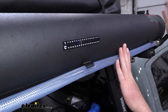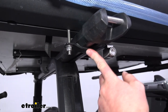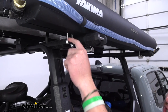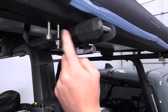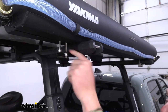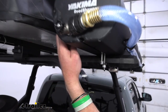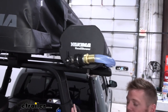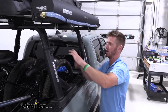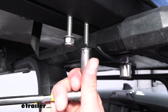On a really hot day, it's going to heat up pretty quick. You get a set of mounting brackets with a little piece of foam underneath so it won't scratch your bars. There are two different bolts that slide into a track — the skinnier one is for factory rail systems, but we have it on Yakima HD bars which are thicker, so we use the taller bolts. It can be mounted on the bottom or on the back track, which is useful for the Yakima ladder rack system like the Outpost. You can also mount it on the side using sidebars. All you need to tighten it is a half-inch socket.